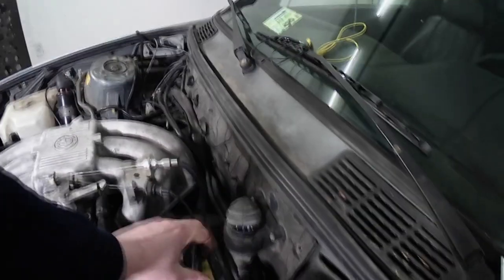Okay. Another reason that the DME doesn't get power is these cars have an OBC, an onboard computer, and there's a code feature in them. And if that's not connected, if you unhooked the DME or unplugged anything under your dash, then check and see if that's unhooked. Okay. So the OBC relay, OBC module, if it's unplugged, you're not going to get power to that relay. Okay. Then the power to the relay comes through your C101 connector.